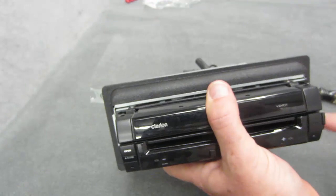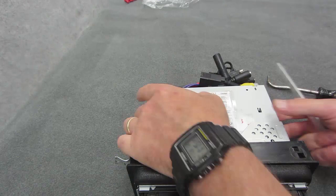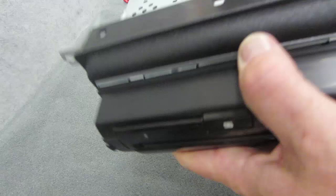If it goes a little heavy in the back, what you could do is use one of these back straps — mount that onto the supplied hole on the back of every stereo receiver. If you ever wondered what those are for, that's so you can take a bolt, mount this back strap, and get behind there. You can angle it up or down however it needs to be to keep it secure from the back or front, and it also keeps it secure from somebody stealing your radio.